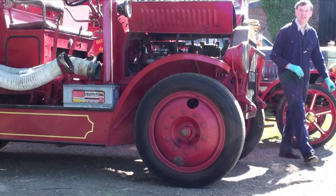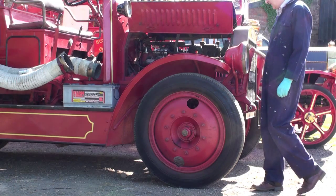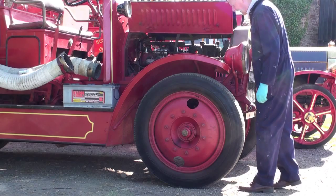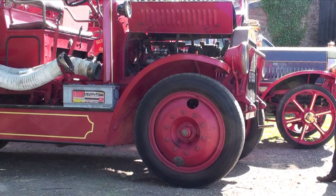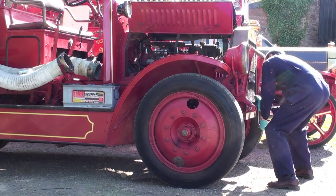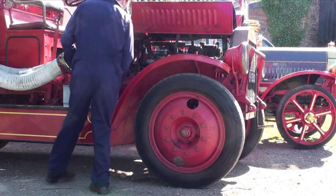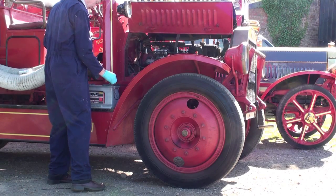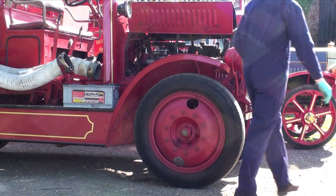Not quite. So we're going to repeat the exercise again. We're going to give it a couple of turns, which will bring it to top dead centre on the compression stroke, flush the battery, give one single spark, and that should be enough to make it fire. Okay, flush the battery. He nearly went, but not quite. So we'll start again.